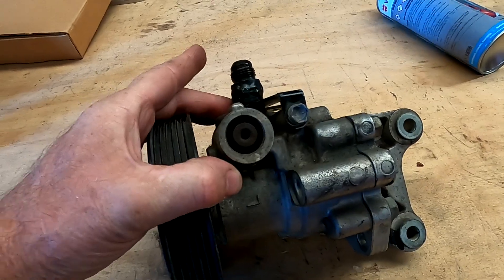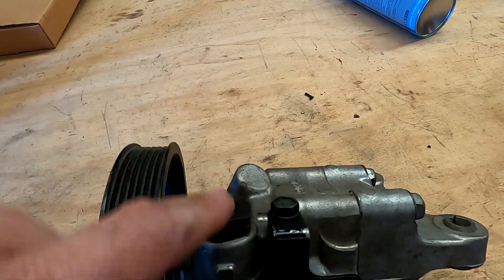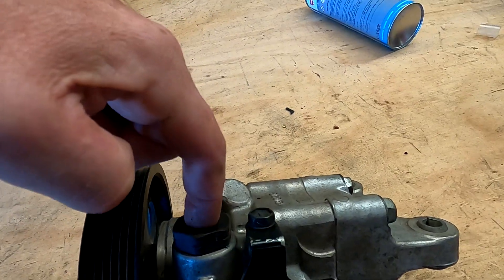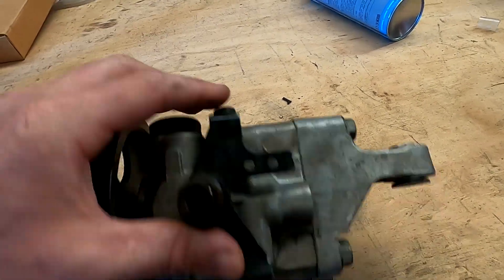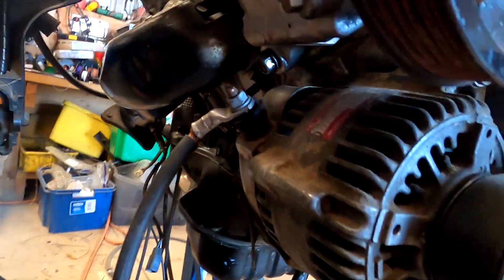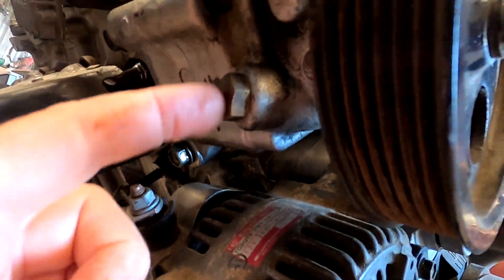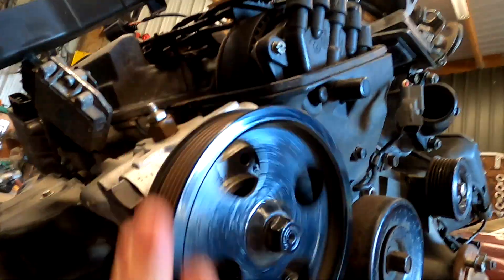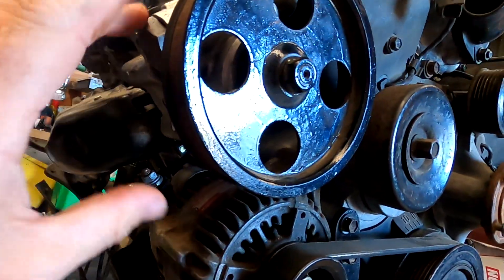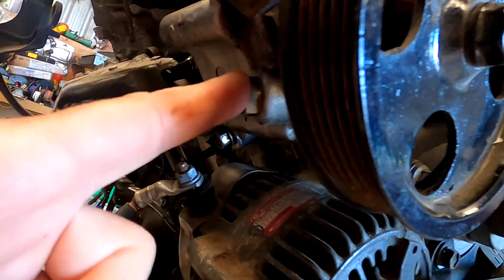It's located there on the power steering pump — that is a SORA pump. On SORA pumps they are located on a banjo fitting on the high pressure line. Yellow has got a pump on it; old Yellow doesn't have a pump. We'll use Joey here to show where they're normally located. This one, as you can see, is actually just an idler — it's a dummy pump with no fluid, just a bit of grease to keep the bearing happy. That one's been blanked.